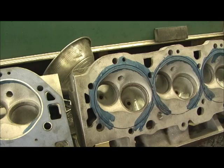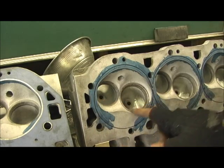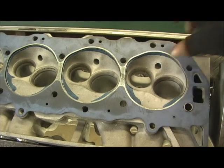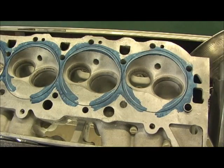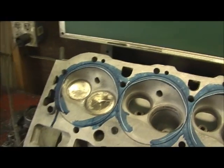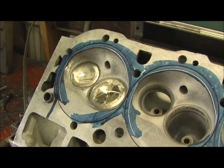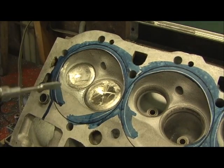The chamber's in pretty good shape, but there are real bad machinist ridges in it — I'm going to clear all of them out. Let me go ahead and remove the gasket on this one. I've already got my dummy valves inside this one here, and what I'm going to do is go in here and unshroud the combustion chamber some, but mainly get the machinist ridges out.